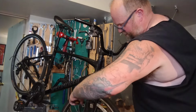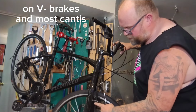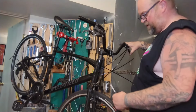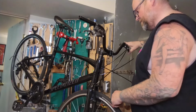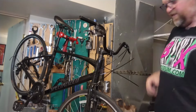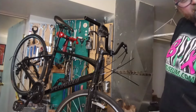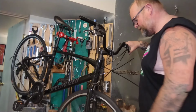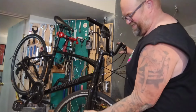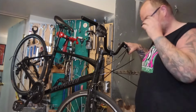Let's turn the spring adjuster in. This is a little screw down here around the side of the brake. It pushes against the spring and adds tension. Now it's pretty even. Just a couple of twists of that screw. Doesn't take much. The other side's already out a lot. I don't really want to mess with it if I don't have to. And if the springs are real crazy, you can take one of them out and bend it more to add some more tension to it.